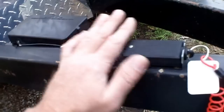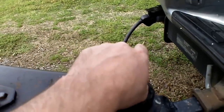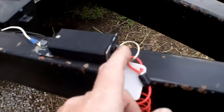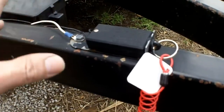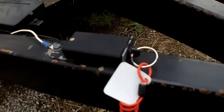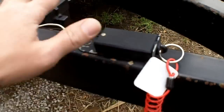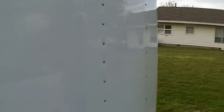You can test the breakaway battery and brakes, but when you run this test always disconnect from your vehicle first — it can fry the brake controller. To test it, disconnect the whip, simply pull the pin out — they're not easy but they come out — then walk around the wheels and listen for a light hum, or start the vehicle and try to tow the trailer and it should sit firm. Put the pin back in and you're good. They make charging systems that charge the breakaway battery off the vehicle, but I don't have one in it yet.